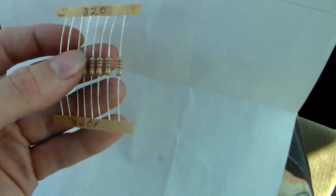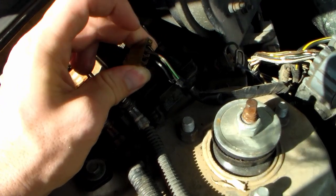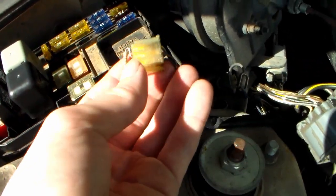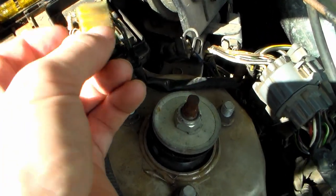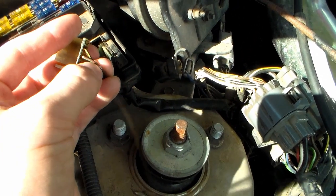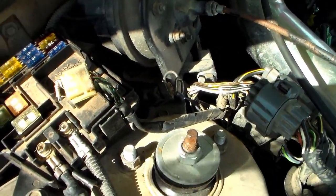They came on a little card like this. I picked these because they were carbon film and had a higher heat tolerance. I looped it in between the solid black wire and the middle wire, which is a green with red stripe wire. Do not touch the black with yellow stripe wire — that's to your ignition and you will blow a fuse or something else. You only want to do the solid black wire and whatever color that's not black and yellow — jump a resistor in between those and that will get you home if it blew.